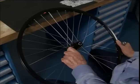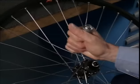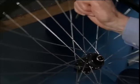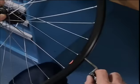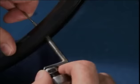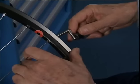We turn over the wheel and again use the tool at each spoke crossing and pull in the direction of the hub so that the spokes are straightened. Now, each nipple is screwed in until the nipple driver stops. Or, with the screwdriver, until the thread can't be seen. With this last spoke, we are now finished with spoking.